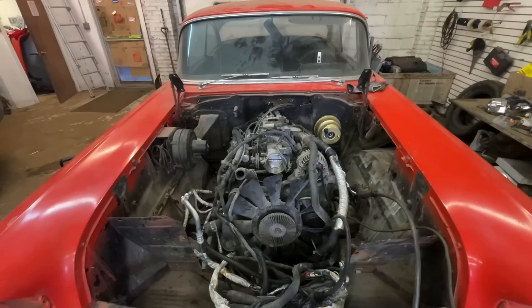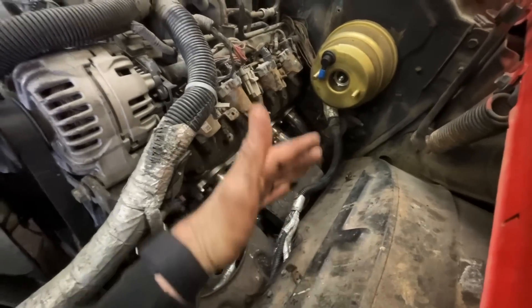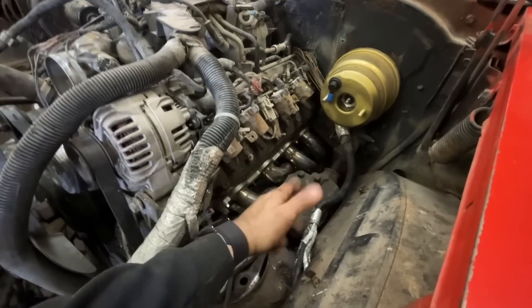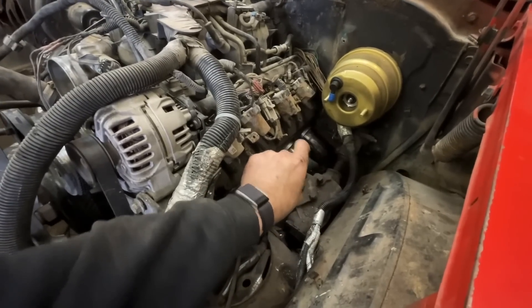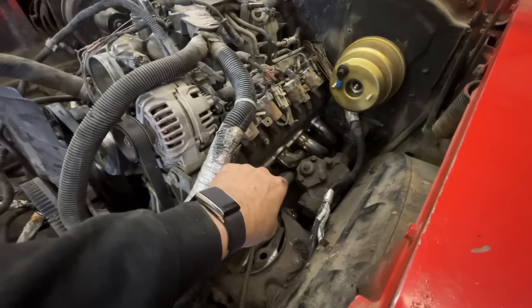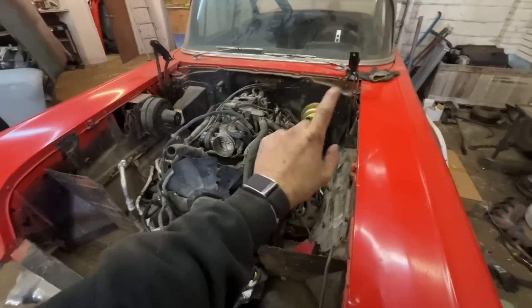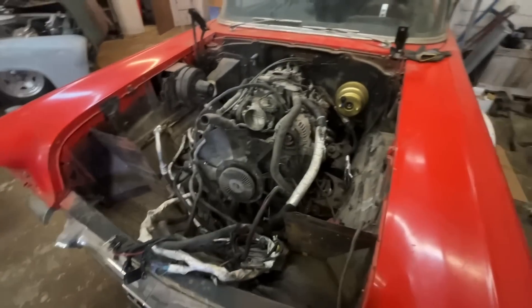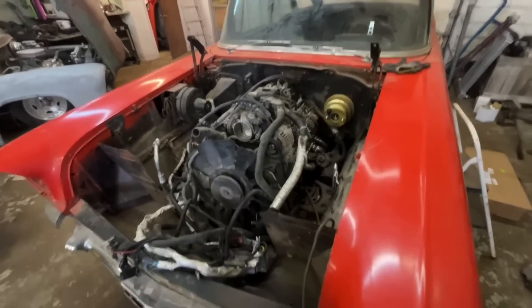We did it — exhaust is in! I've got a ton of room on this side, which is great. I did have to dent it in a little bit — I'm not sure if it's because the motor is set back an inch or it's just angled enough where it wasn't working as easily as for other people. I ended up taking a full inch out of that second pipe, and the third pipe I slightly rotated. Either way, we're good. They need to be fully welded another day — I'll take them off and finish them — but I'm going to fit the brakes on and a couple other things to make sure everything is sitting good, then order our radiator.